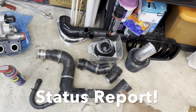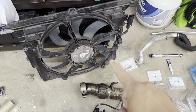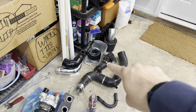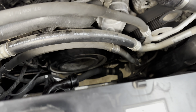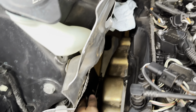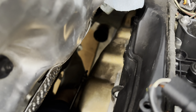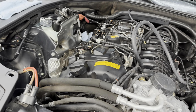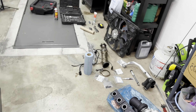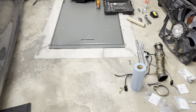So far: the Bimmer House intake prototype is off, the downpipe is off, the shield is off, the fan is off because I had to get the boost pipe out of the way, and we've drained coolant. The water pump is sitting right there. That was all so I can get the last bolt of the motor mount out. You can hear it — that's the motor mount and motor mount bracket, it's loose in there. I just need to lift the engine more to get clearance to remove the motor mount, and then I can take off the turbo. We also had to remove the coolant pipe. We're making progress.